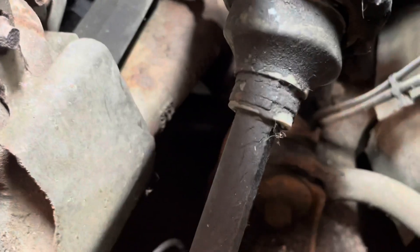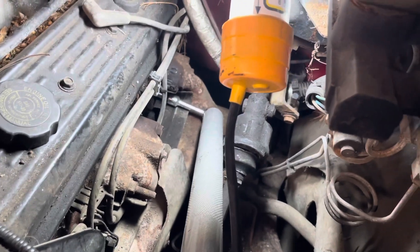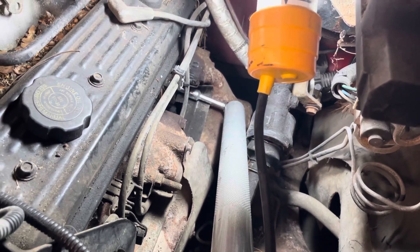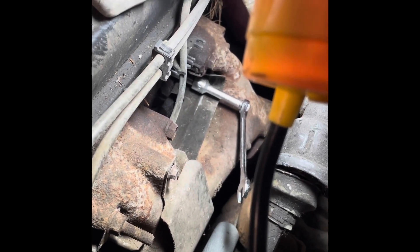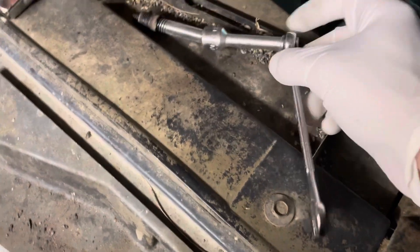What I'm doing is using a breaker bar from my car jack - it's just a pipe, but anything that'll go over that to spin my extractor will work. I've got a lot of rotations to do - if you've ever put in a spark plug you know it takes a few cranks with a ratchet. I've been here for what feels like forever and I can finally start to turn it with my hand, so I know I'm getting close. Take your time because you don't want to snap that extractor off in there. Well, she is out!